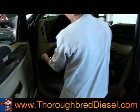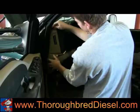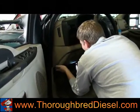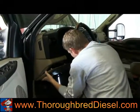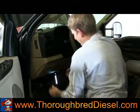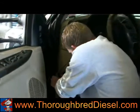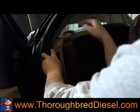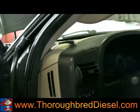Once we're around here, this crease right here in the door panel is where we're going to make this cord stay, and then it'll hook to the tuner up here. We're putting this panel back on now that we've got our wires run underneath — it snaps in. We've hidden the wires right here in the corner; you can barely see it, and it tucks behind the whole seal going all the way up, so you just have a little bit of wire hanging out up top for your monitor.